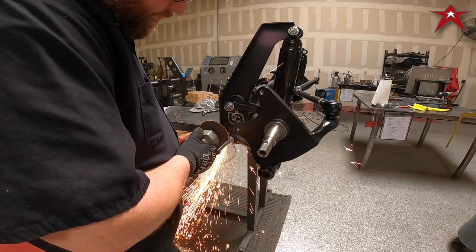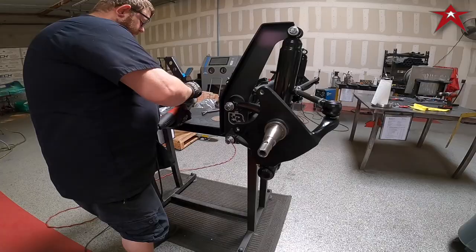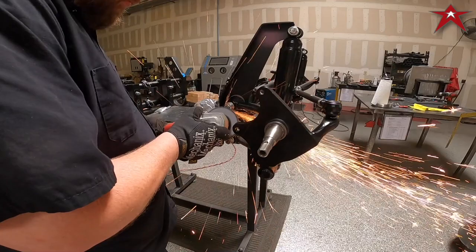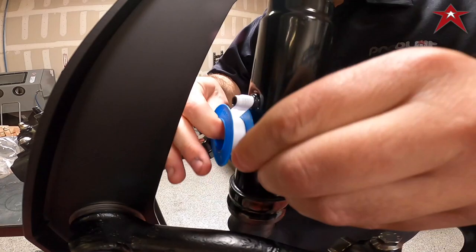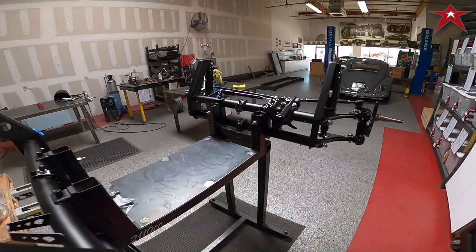You'll notice the through rod is hanging out — you don't want to leave that there as it'll snag your tire. So we use a cut-off wheel and a sanding pad to make them flush so that if your tire connects or touches it, it won't damage the tire. On our air shock fittings, we recommend Teflon tape and recommend wrapping it in the direction where you're not unpeeling the Teflon tape on the shock itself, so that it helps with the sealing process.